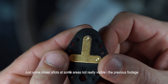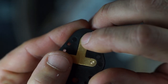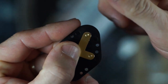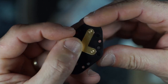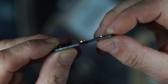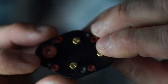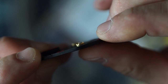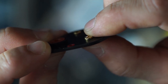Okay, so it's not horribly uncommon to see a little bit of arcing around the shape of the button. That's going to depend on which way you're pushing the button, how well the button assembly is centered with the switch leg, a couple other little things. Something else you want to look at is making sure these screws are tight and that none of the heads have tool marks or sharp edges from being tightened.